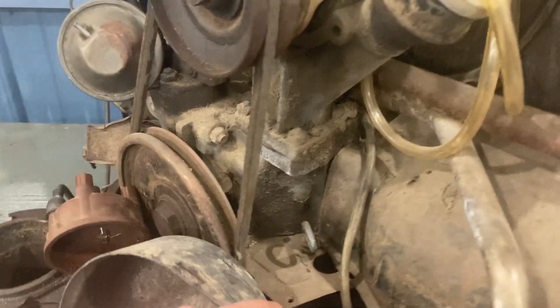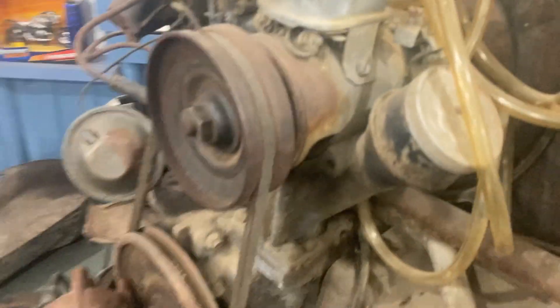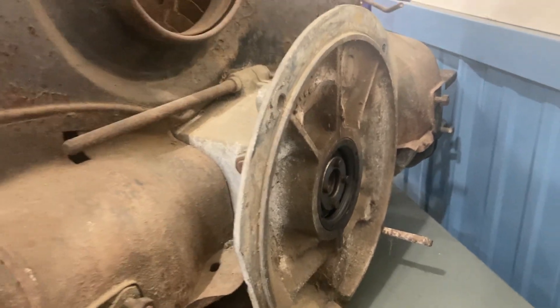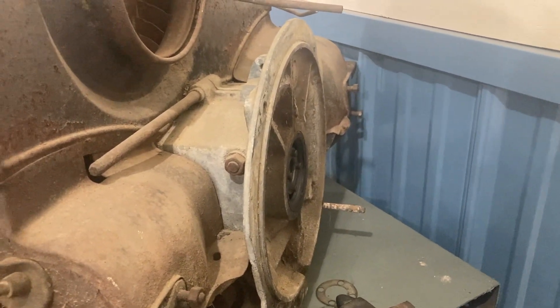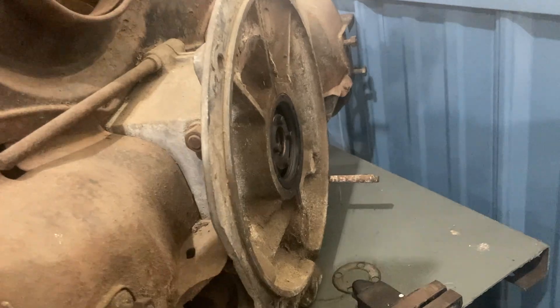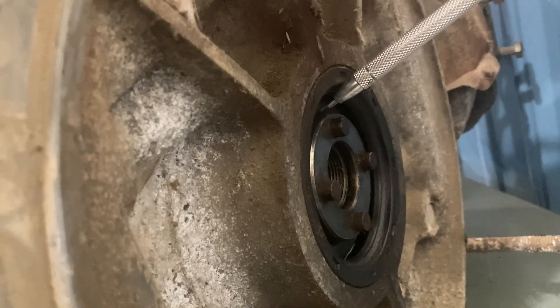This is the old 40 horse project that I am working on, and this has got a long ways to go. We've got mouse nests in the shroud, hasn't been running a long time. But the flywheel was taken off and somebody had asked the question: can I use the flywheel off a 1600 12-volt vehicle and put it on the 40 horse to run it as a 12-volt? And the answer is no, you can't just swap it out, because the crank on the 40 horse - the end is different than the crank on the 1600.